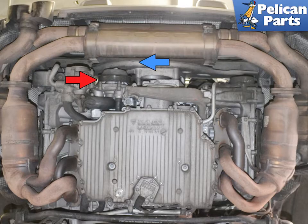The coolant pump is located on the left rear side of the engine and indicated by the red arrow. It cannot be replaced without moving several major components. While you can loosen and slide the engine carrier back an inch or so to replace the pump, if you are doing this for the first time or just want to do it right and not cut corners, this will show you the safest way.